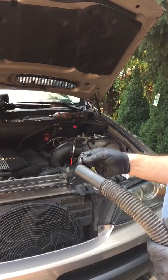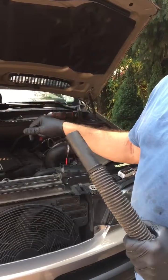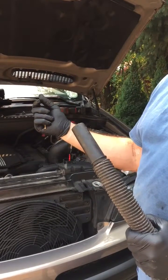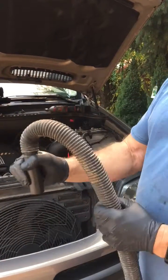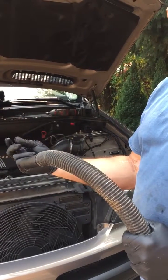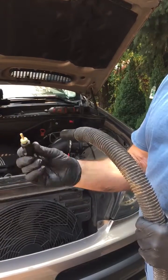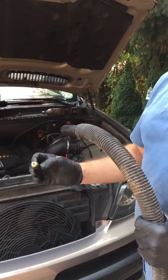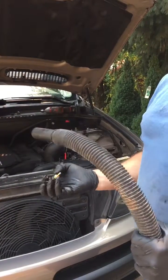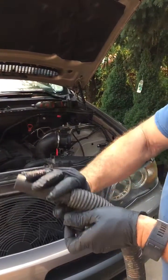You can also use this vacuum method for changing a damaged oil plug or seal on your engine by pulling a vacuum and having somebody change the drain plug at the same time. You can do this for temperature sending units or other accessories that go into fluids, but never ever do it with any type of flammable substance.